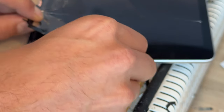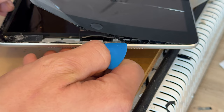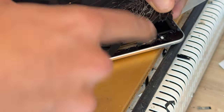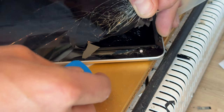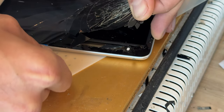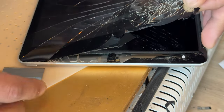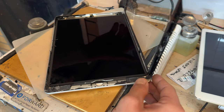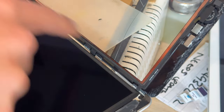You can also lift up where we've already removed some of the glass, and you can see that it's becoming separate. Where the adhesive is stuck to the glass and the chassis, just take your razor blade and cut that bit to release it. We can then move up to the next part using the razor blade to get started and the opening pick to help lift it. Now that we've released those three edges, it should just open like opening the back cover of a book. The flex cables are just here — they're the ones you need to avoid, which is why I don't bother cutting along that edge at all.